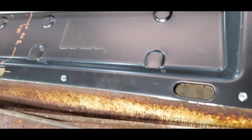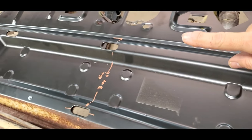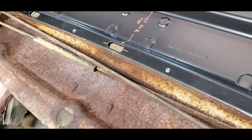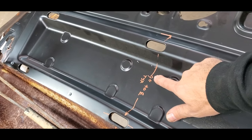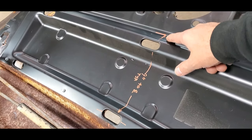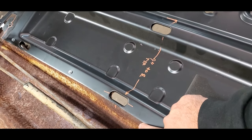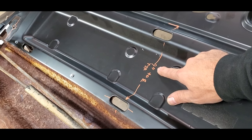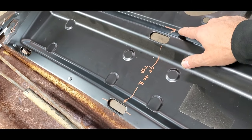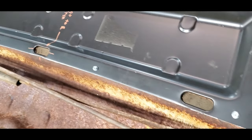You can see these are the reliefs I was talking about — there's a bunch of them — and I made a notation. You can see right here, it's upside down, but it says nine inches to center line, and that's what the factory one was. This would be the shelf of the rear window to the center of this hole on the original panel. This measurement is from the original panel. So I made sure I was able to duplicate that, and I have. We're all good there.